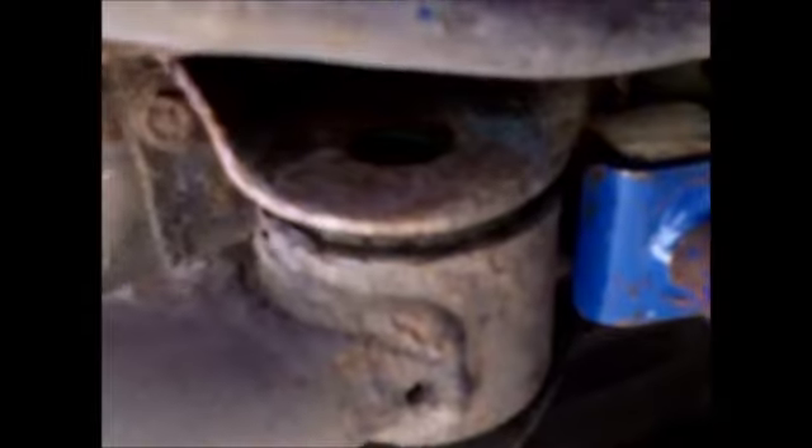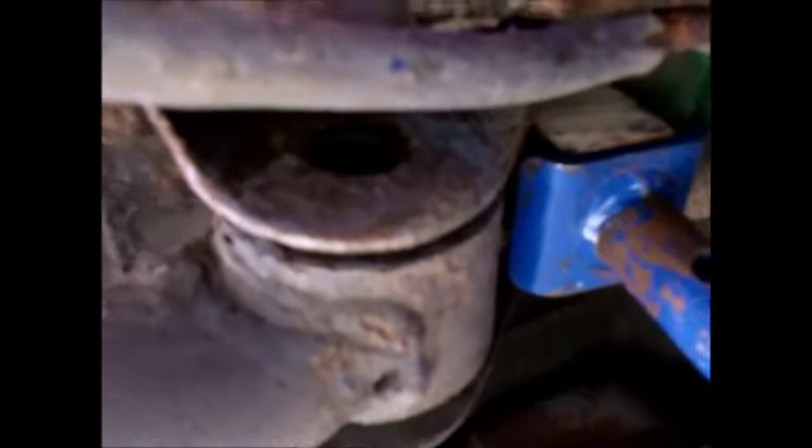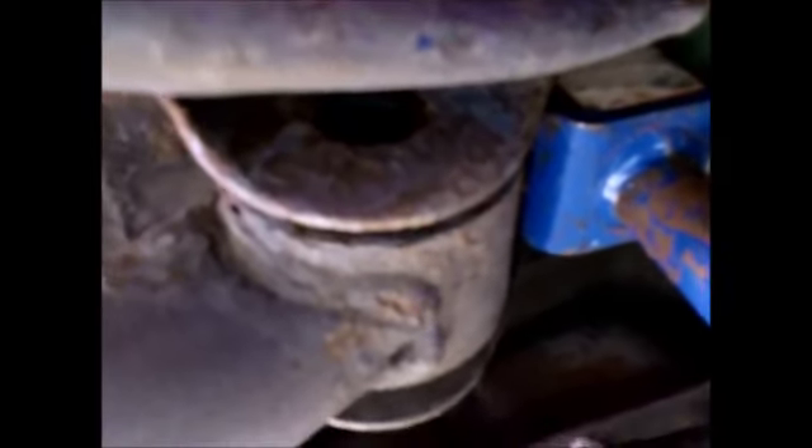If you can see, we've got the swinging arm, the carrier there, and just in front of it you can see I've got the trolley jack with a chock of wood resting just half on the plate and half on there. It's probably not the best place, probably should have gone straight behind it. But still, it's been safe and secure. Give your car a wiggle before you do anything else — make sure the car is actually fully secure before you actually get underneath it.